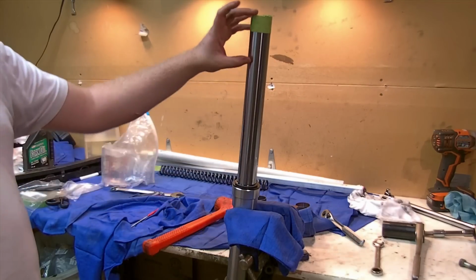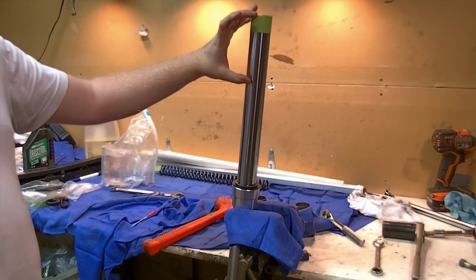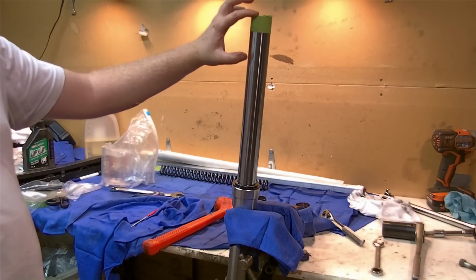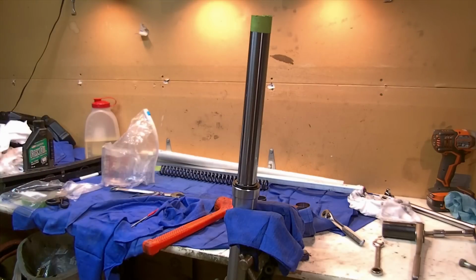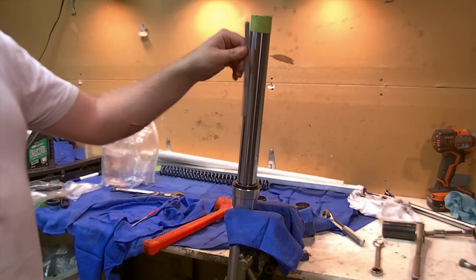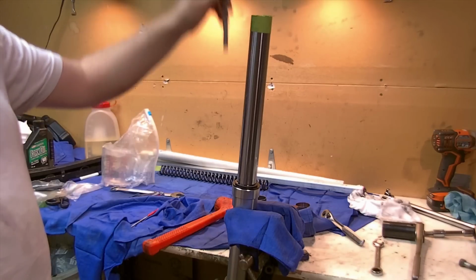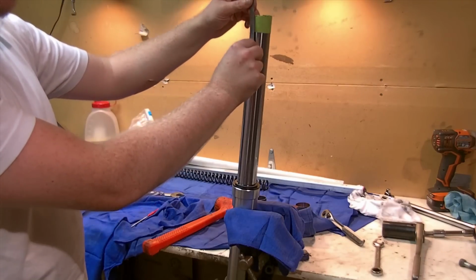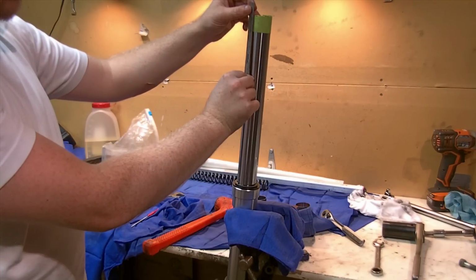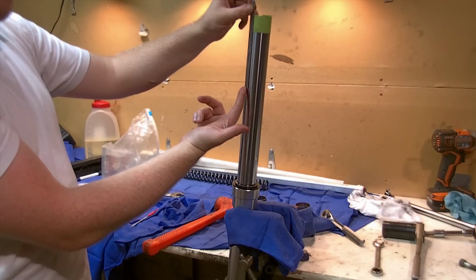The manual will give you that measurement in millimeters. I'll look it up here when we get it later. It's somewhere in the neighborhood of like 137 millimeters from the top. A couple ways you could do that. You could take a scale, a simple scale like this, and you could put it in there. You want to make sure it's clean. And you could hold it against it and look down. This would be on the inside. For example, say you put it on your 137 millimeters there, and you fill your oil up to the bottom of that while you're looking in there.